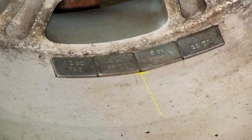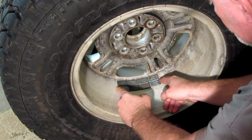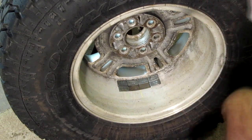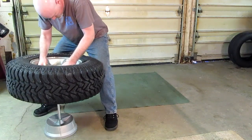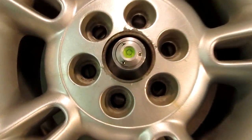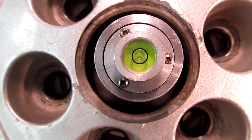If the mass is off-center, then unless you're very lucky, a dynamic imbalance will be created — or increased if it already has some. We don't want that. Once the wheel weights are on, it's time to double-check the static balance. Right dead perfect.